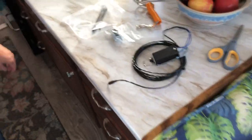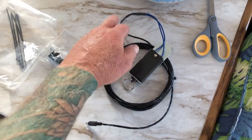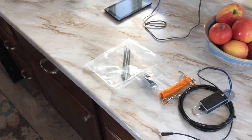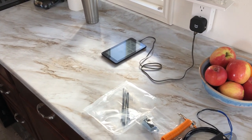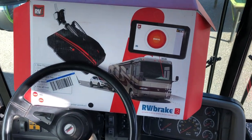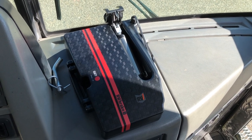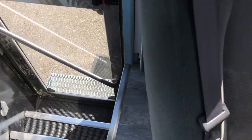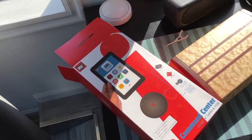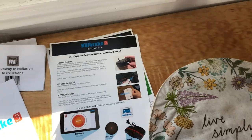Right here is the basic breakaway system which goes on the front of the pickup bumper, and then this leash cable goes from the bus to the pickup. If the pickup ever came loose it would pull out this pin and put the brakes on in the truck so it didn't go flying down the road without the bus. The one we chose is the RVI Brake 3, which comes in a package deal. The actual brake is removable - you just take it out of the pickup and stow it away when not using it. It also comes with this tablet and hub that Bluetooth connects and has way more functions than just the brake.